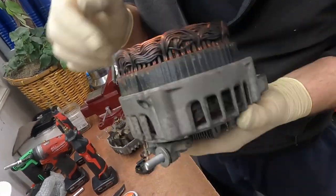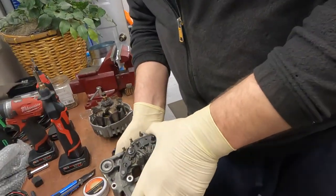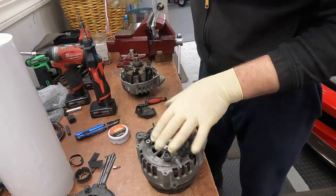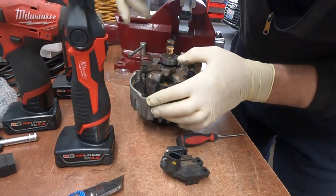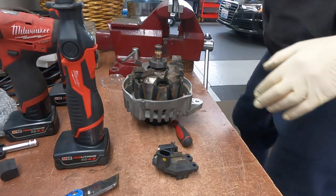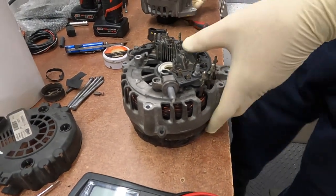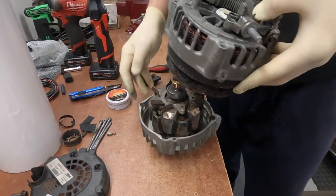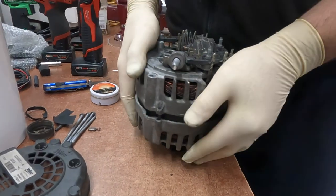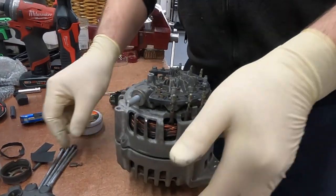Now you can see, everybody, that plastic cup, it's good, it's tight. I just want to lubricate a little bit, just simple grease around the bearing. This lubricant, it's going in really smoothly. You need to press it into this starter, just align it, and then press it in. You can hear it's nice and smooth going in, going in.